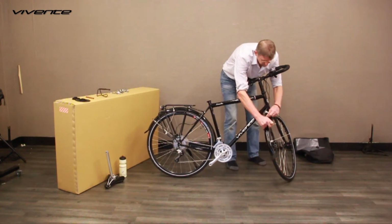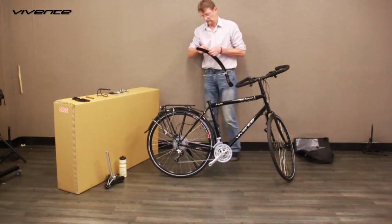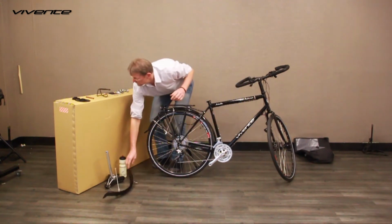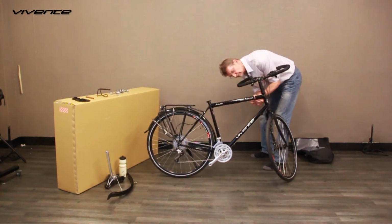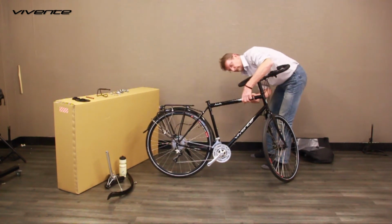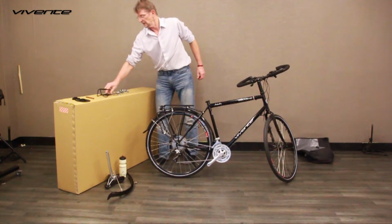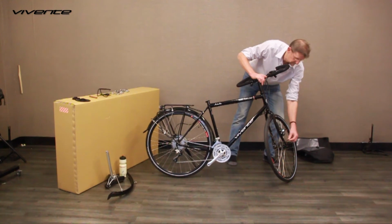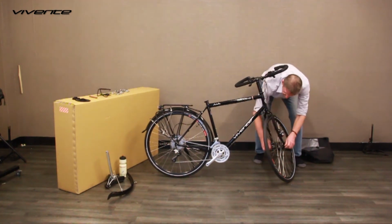At the front of the bike, if you have a front rack, you'll need to remove it, but we don't have one in this example. You can just leave the headlight hanging down for the moment. The rear brake housing is attached on the underside of the top tube in 3 places. Being careful to not harm the housing, remove the forwardmost C connector and return it without the housing to the same spot. With the wheel still on the bike, remove the front skewer.